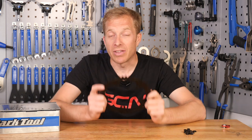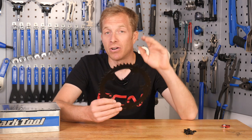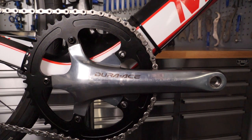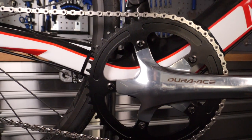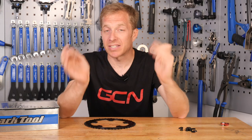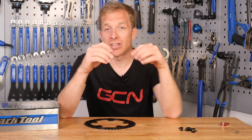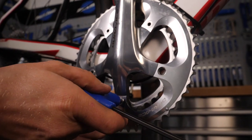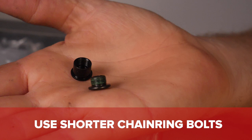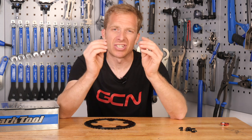We also need to make sure the chainring fits the chainset correctly. I've really hacked this together — I have a Campagnolo groupset and I'm using a Shimano chainset found in the workshop, which fits perfectly using a 130 BCD. To attach the chainring onto a standard road double chainset, you'd normally have an inner chainring there, but since we're removing that, the standard chainring bolts will have a bit of slack. So I've sourced some shorter chainring bolts — the type you'd find on a single-speed or BMX bike — or alternatively you could use thin washers on the bolt or nut to take out that slack.